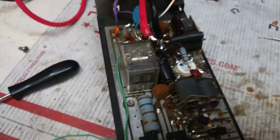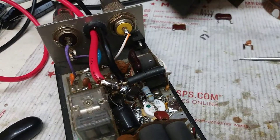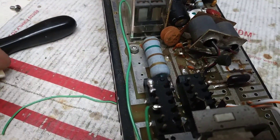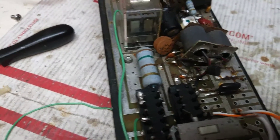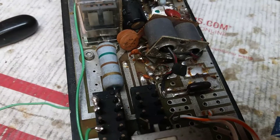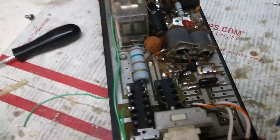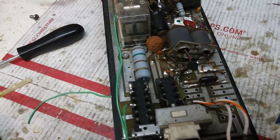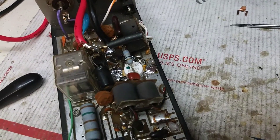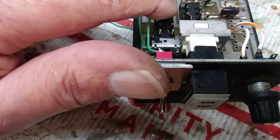I'm looking at this part — it's got the little indentures on it for these. This one here is switching this one — these two together. Took a little piece of Teflon wire. Still wasn't working. I know the HG pill's good, so it must not be getting drive. So I jumped these two over here on this side and it started working — this side for the drive.